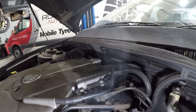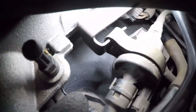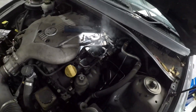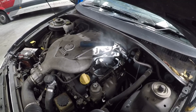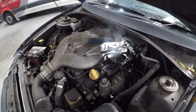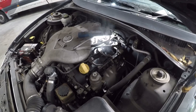Let's go smoke and see if we get anything — look at that, you can already see it! Absolutely pouring out — where's that coming from? Coming straight out of that hose there — that hose has got a massive split in it. Hopefully you can see that split — that's what the leak is, that's why we have an extremely poor idle. My face is covered in smoke at the moment, it's absolutely pouring out. With that much vacuum loss at idle, of course it's going to run like absolute crap — that's why our short-term fuel trim is just pegged, full steam ahead at 25, and then it realizes there's an issue and puts it into an open loop fault strategy.